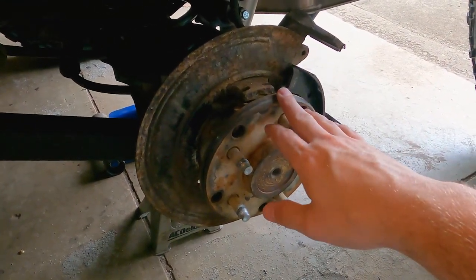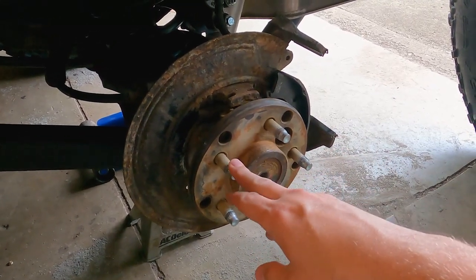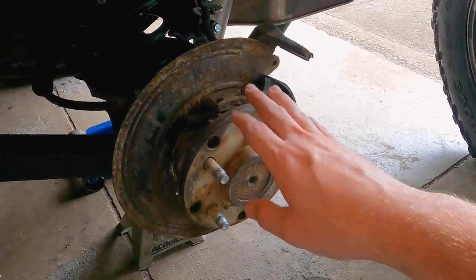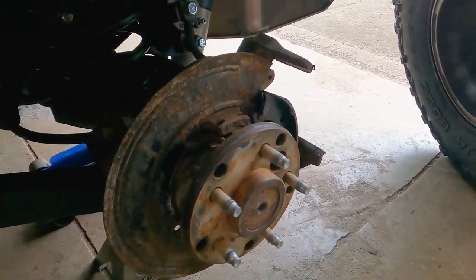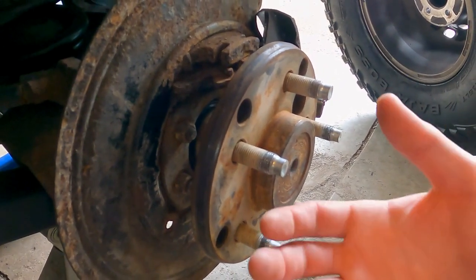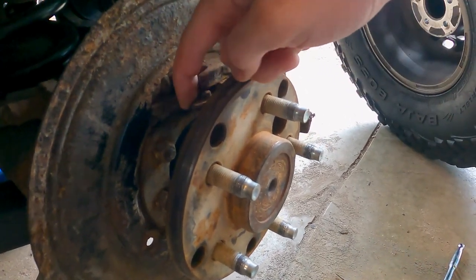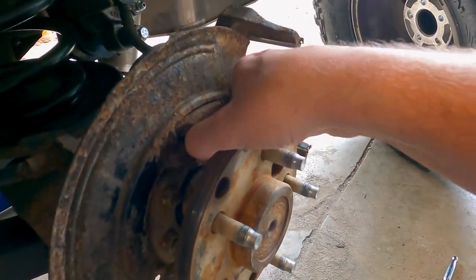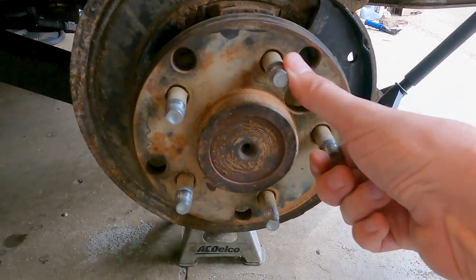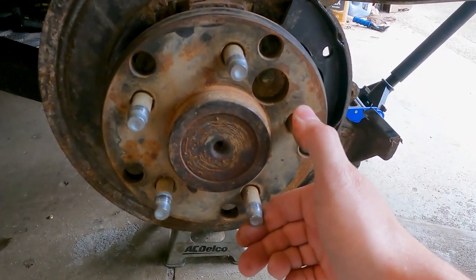If you need to see how to get to this point and remove your brake shoes and everything, go watch my other video I just did on actually doing the brakes — that'll show you how to remove it. For this, I'm going to start here. The first step is to remove these four bolts on the inside. That'll help me pull the axle shaft out. I'm not going to pull it all the way out, just enough so I can then remove what's left of this bracket in here. There's a big hole right here on your shaft so you can spin this and line it up with the bolt holes and get a socket on there.